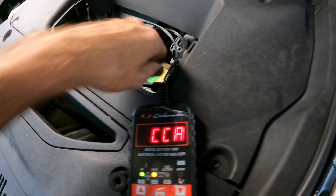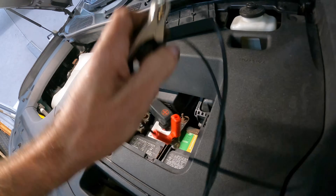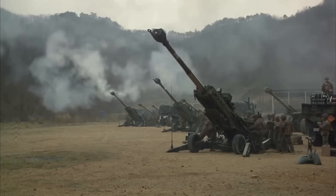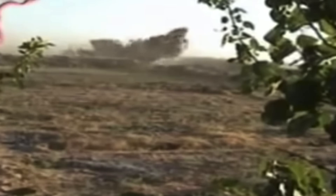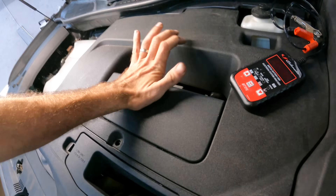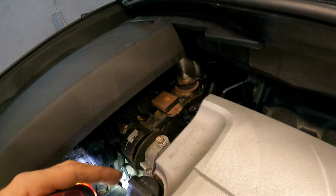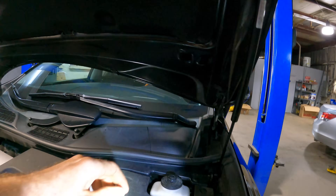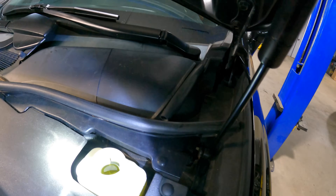458 — that's recommended as a weak battery, that's not okay. We retested and still got 458. It fired right off, but the battery is weak. Let's take a look at this torque mount real quick — these things like to tear. That one's good.